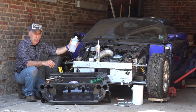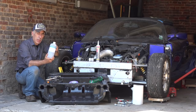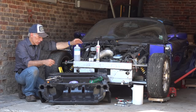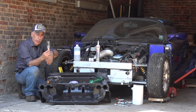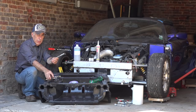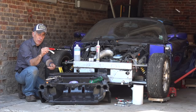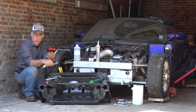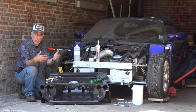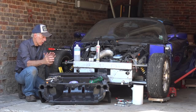Before you put it all on, you need to clean everything so there's no grease left on it. I'm going to use isopropanol, which you can get in any pharmacy. You're also going to need some tools: a very clean brush to apply the primer, some measuring tools because you want to align things right, and a marker to set reference points on the rig — a supporting structure that you'll use to mount the crash box properly.